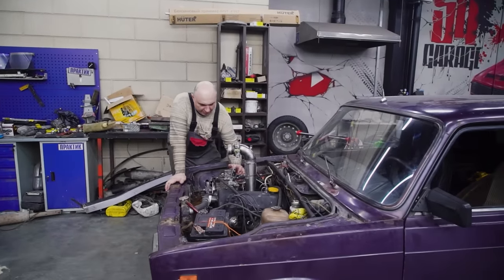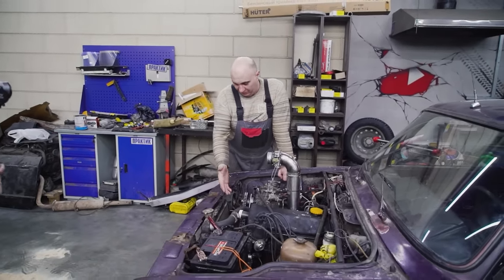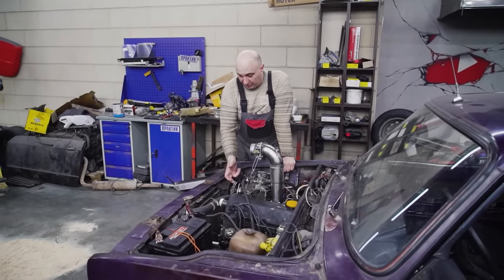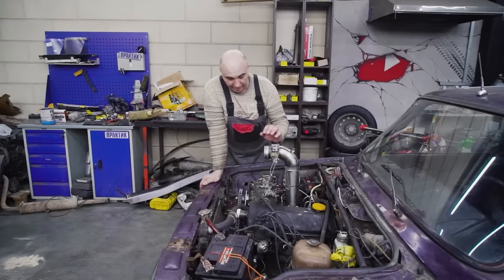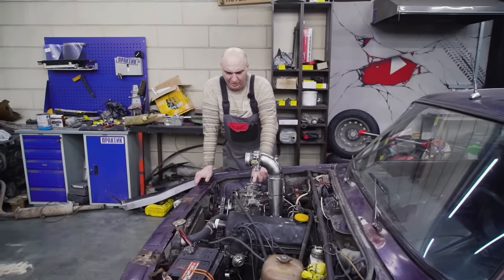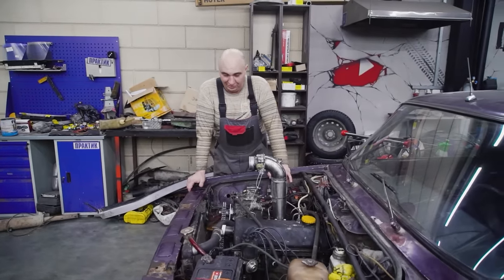Here's the situation, fellas. We've got the fuel pump on there, the chain — we pulled the sprockets from a Lada engine of the same type as this. Down there we mounted a sprocket of the sort you'd find on the crankshaft, while on the pump itself we have one like you'd find on the camshaft side of the timing chain — it's just mounted on the outside. As it turns out, the high-pressure fuel pump firing order on the 2CT diesel engine from the minivan is right on the money. Both engines have the same firing order: 1, 3, 4, 2 — which made it just that much easier to put all of this together.